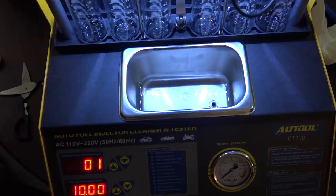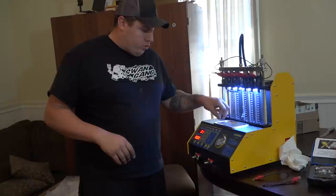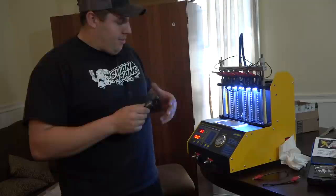So that happened over at TKM. Kevin showed me about it. And actually, Kyle, I want you to hold the camera again so I can explain this. We're new with the camera and the microphone, boys. We'll get better, I promise. But basically, you fill this up with your injector cleaner, and it puts an ultrasonic wave through this little piece of tray, machine and everything, and it basically breaks up the trash inside your injector, which allows it to be cleaned out. Then you put it inside here and you go ahead and clean it out.